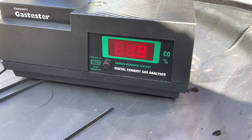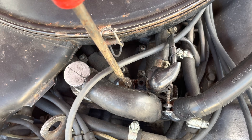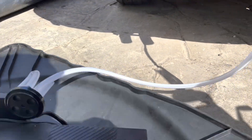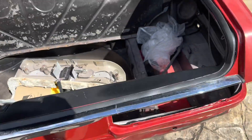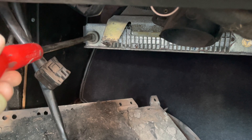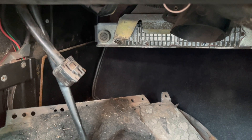1.9 — so we're really in spec. I'm just going to open the airscrew on the manifold slightly to help the engine out. 1.8 — let's see if we can get it a little bit lower. It's actually as far as it'll go, it seems. So I'm going to bring that back up a little bit, because I don't think it should be at the leanest setting — that doesn't seem right. But let's leave it there.